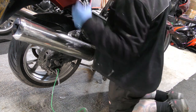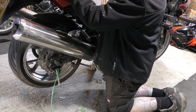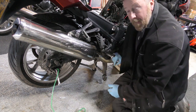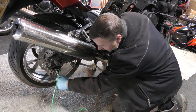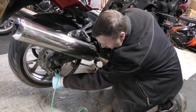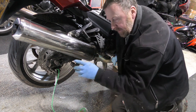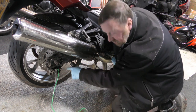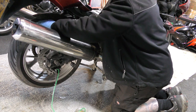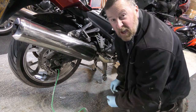I'm going to top it up completely, drain it through, and top it up completely again so there's completely fresh fluid all through the system. We're going to replicate that on the front both sides and then the clutch - exactly the same way. It's not rocket science: pump, pump, pump, let it go, lock it - nice bit of fresh in there. Make sure you get a litre, you'll use it again. Open the valve then close the valve before releasing it. This pipe keeps a vacuum, fills up nicely and stops it spraying everywhere. Do not get this stuff in your eyes.